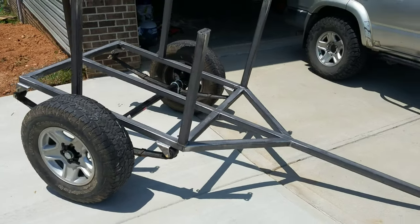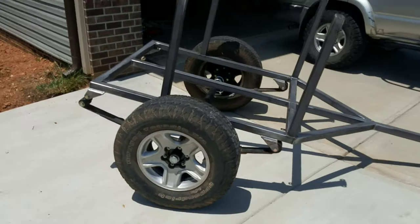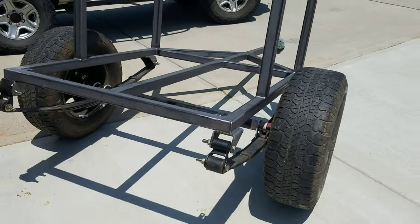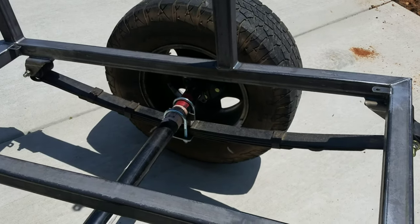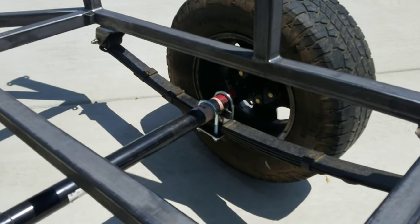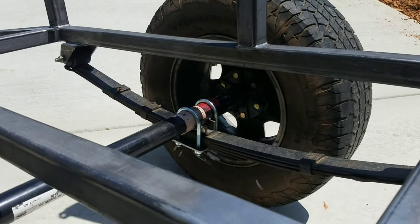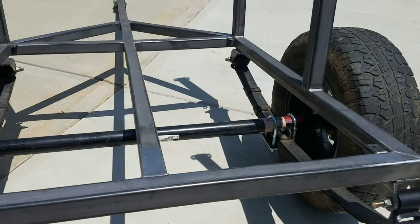As you can see, I have the same wheels on the trailer as I also have on the truck, and the width of the trailer track is identical to the truck. The trailer is mounted on a set of XJ leaf springs. You can see the axle is mounted above the leaf springs and the height of the bed sits about 6 inches above the axle with that configuration.